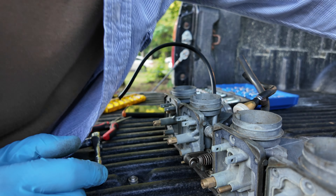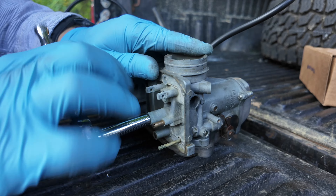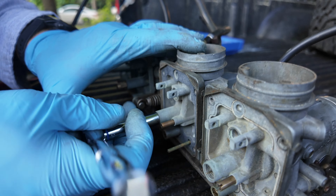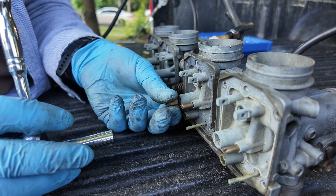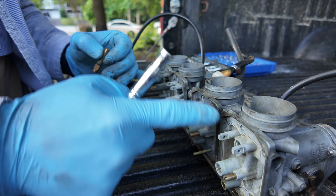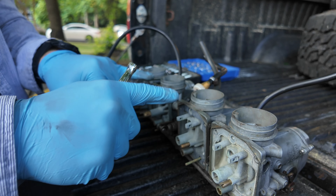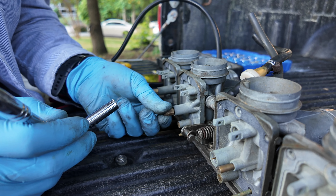How big of an impact should I be using to get these out? I think a three-quarter inch impact is what I need. Oh, that looks a little crusty — it's seen better days. I can still see through it. One important thing to note is that all these jet sizes are actually the same. So if you have a fancier motorcycle, you actually want to take note of what the jet sizes are and where they are in relation to the array. Because if you're working on something fancy like our ZX-11, you'll actually have different jet sizes on the inside versus the outside, and you want to keep track of that. But on these we already know from experience that they're all the same, so we can just toss them all into the same parts bin.